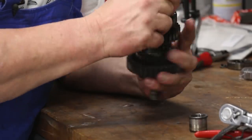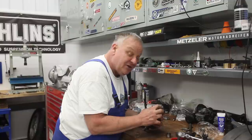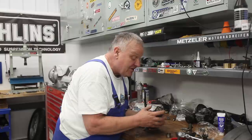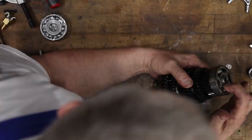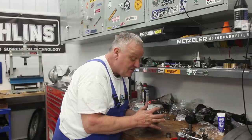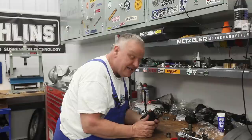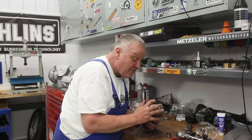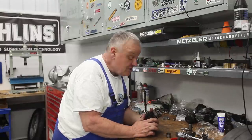And then a word about this rear bearing. So you see this has a circlip installed. Some of the early 5-speeds had that, some of the later 5-speeds didn't, but it's not a bad idea to have it on there. It keeps the shaft from sort of wandering on there. And this is a modification that we can do here in-house if you have a box apart and you don't have that circlip on there. It's a good idea to have that installed and have that machined out. So something we can help you with. And whenever we rebuild these big gearboxes, if it doesn't have the circlip on there, we just do it. It's just part of our transmission rebuild service that we do here.